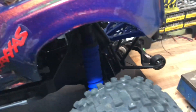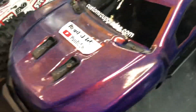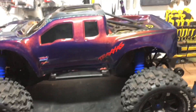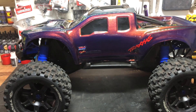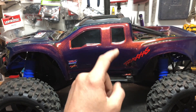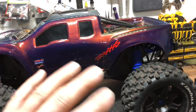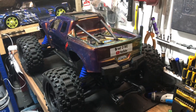Also added a few more bits to the shell — put a support on there, big shout out to Bigfoot Customs. A few more stickers, a bit of Traxxas branding. Going to take it out tomorrow for its first shakedown — there'll be about six X-Maxes out. I've turned the punch up a little bit, swapped to a 20 tooth pinion, put a GDS hardened spur gear in, and all the bearings throughout the whole car have been changed. It's looking good and going well — really happy with it.